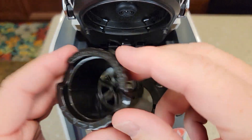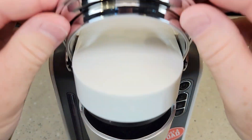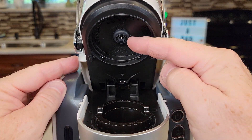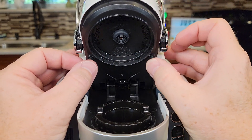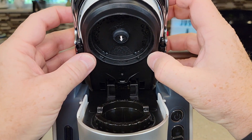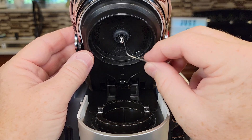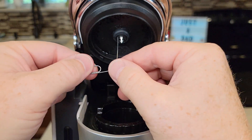We're going to reinstall it — the needle goes up this way. You've got to start off and then rotate it. Make sure it's nice and flush. Practice closing this and make sure you don't force it. Now let's do the top needle. It's a little trickier because you've got to get that needle to come down first. Normally you can't rotate this handle down, but if I press both these little tabs here, simulating that it's closed, now I can close this handle. Be careful — that needle pops out now. So now the needle is popped out and I can clean it. Go up both sides. Be careful, you don't want to poke this all the way. I like to rotate it as I poke it, and then we're going to go in this way.